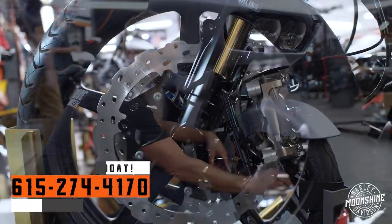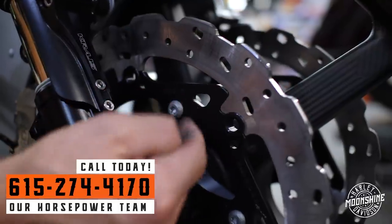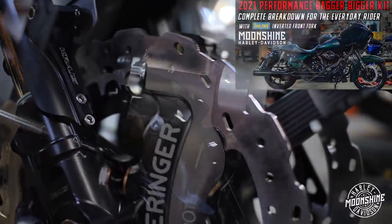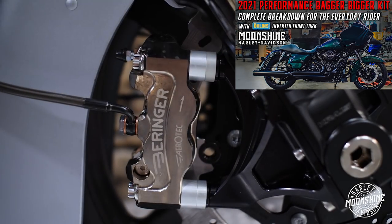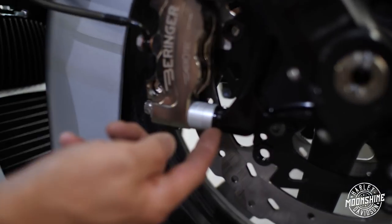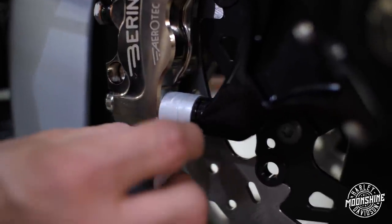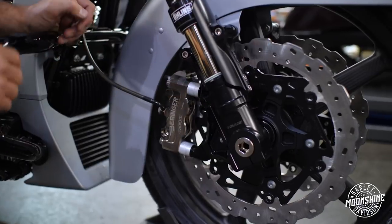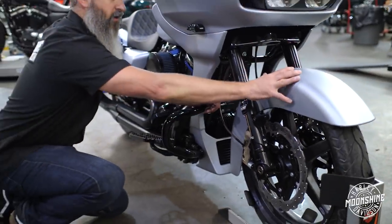The rotors we run are full floating rotors on the front. The only difference is when you hit the brakes, the contact point is here instead of on your button — it is a lot better setup than some of the other guys on the market. We've talked about that in depth in the last two videos. Got Brembo radial mounted calipers on this bike. We got a custom pair coming, milled out to the exact millimeters we wanted — 24 millimeters. They are being cut by Kraus Moto just for us. It is a 320 millimeter setup.